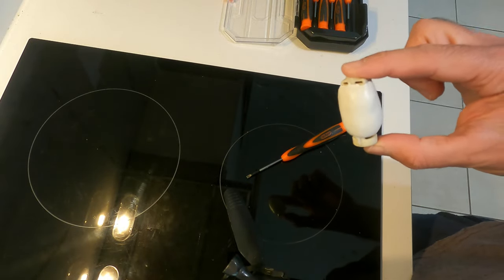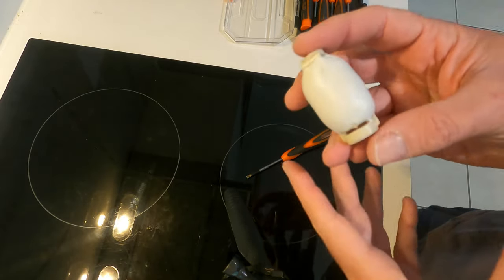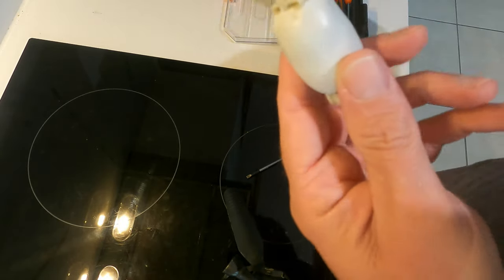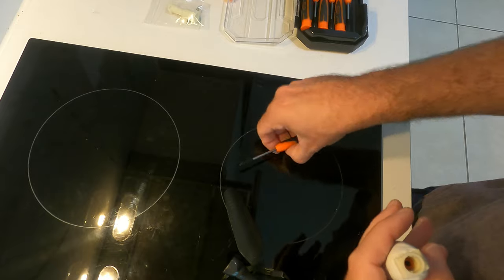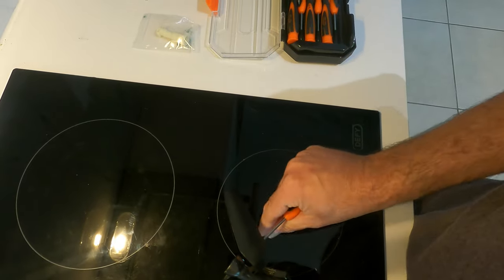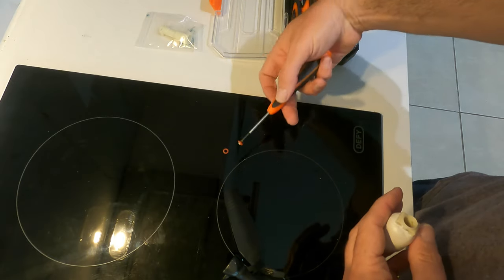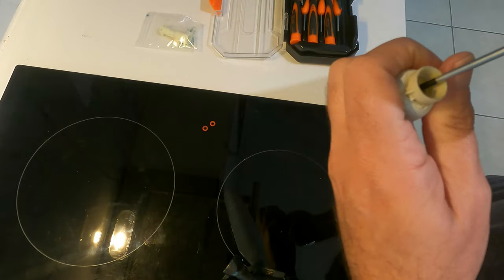The part took so long to come that I was impatient and tried to put some sort of putty on it — it didn't work. This part works under such high pressure. Now that we can replace the old part with the new one — note that it comes without any rubber seals, so you need to remove those seals from the old part yourself. I've already removed the first one using a flat screwdriver — be careful not to dent those small seals.